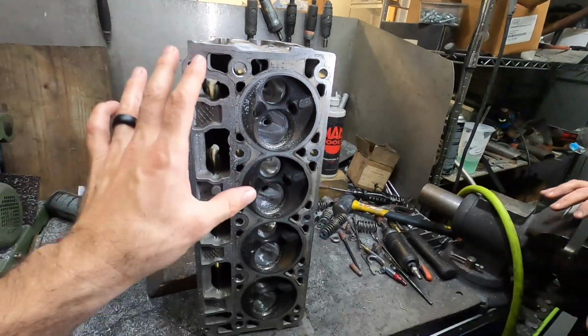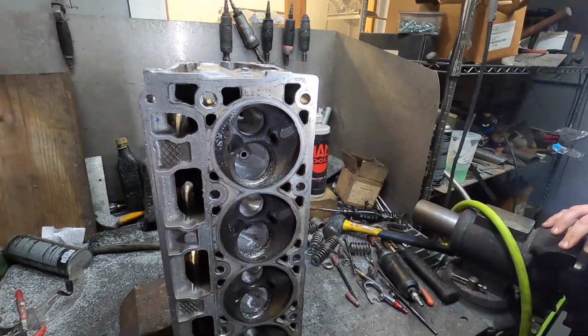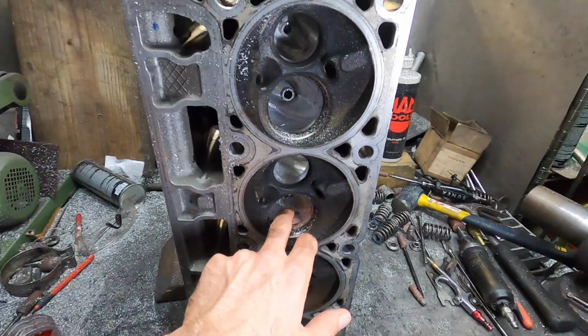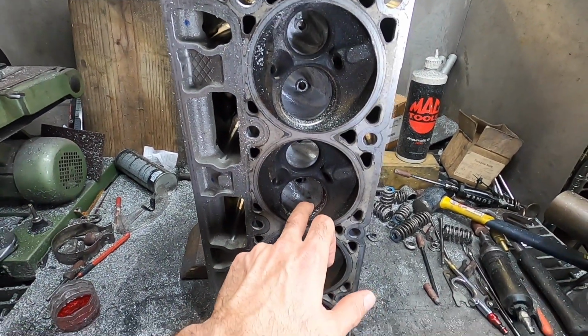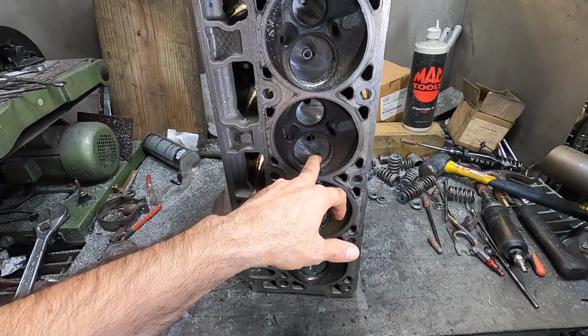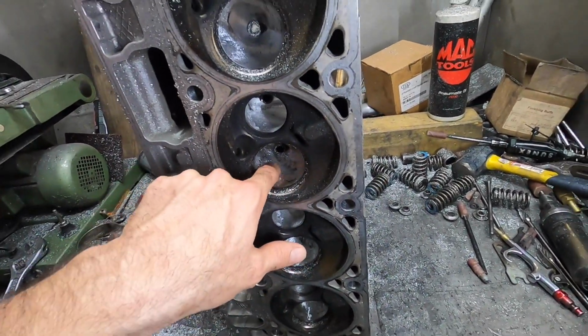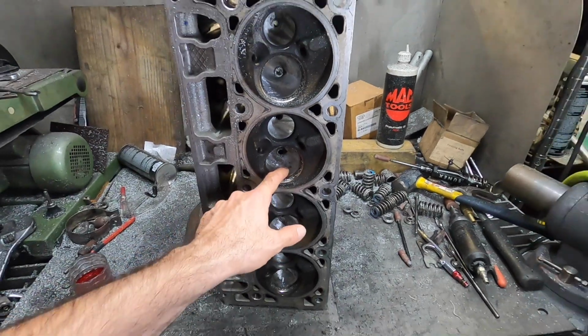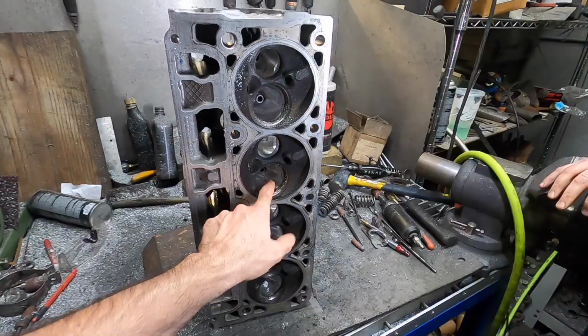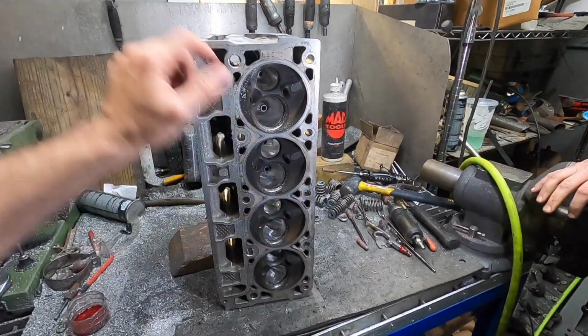We're not going to dive too terribly deep into the porting here today, but we have a ton of other videos that we've done all sorts of different porting on. And the thing we want to say over and over again is anything that drags your finger is going to be slowing that air down. And that is a fantastic transition right there. You can still see a little bit of the casting mark, but this last half inch, last 5/8 of an inch was quite a bit bigger, and that is such a nice smooth transition.